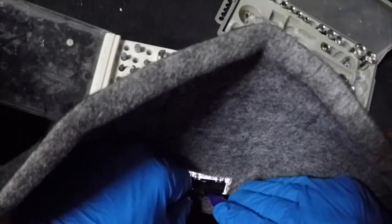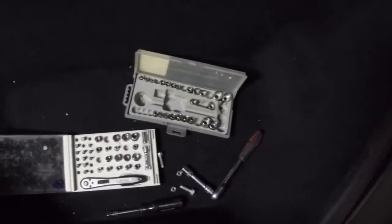Now that we've removed all the bolts, we need to focus on the clips. There are 2 clips, one for the light in the frunk and one for the frunk release. The easiest way I found is to use your trim removal kit, tool, and or a screwdriver to unclip those.